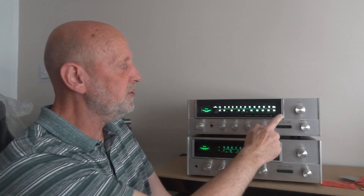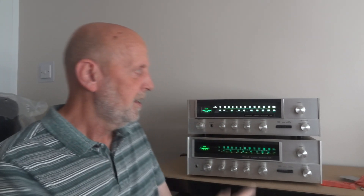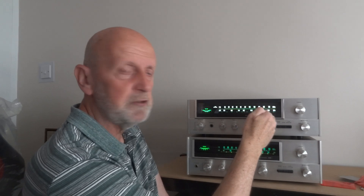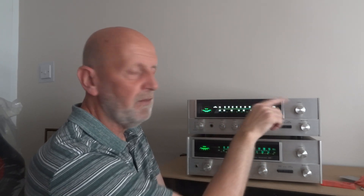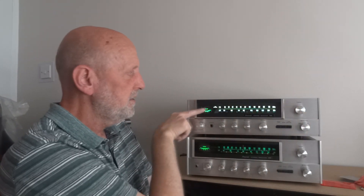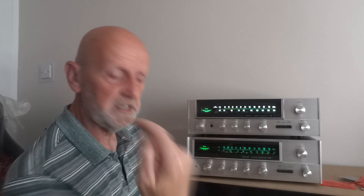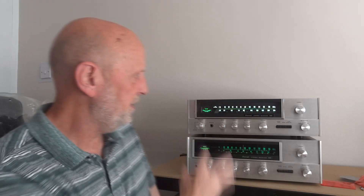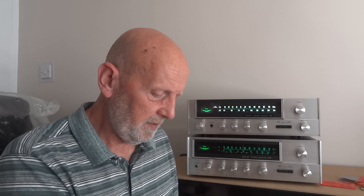You can also get control of these bulbs by how you position them in the sockets. You can turn them 360 degrees, which changes the intensity of the light — obviously the light will ping in one direction, so if you face it towards the back, more light goes that way and less comes through the dial, toning it down. If you face it the other way, you get more brightness through. You've got a kind of dimmer control just by turning that bulb around — maybe 10 or 20% variation in brightness.